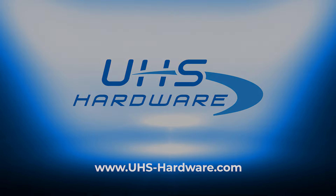When it's all said and done, you should just have a brake light showing. Once you have that, go ahead and hit okay. It gained access — gives us our component security as well as event, and shows we got two keys programmed. It tells us if we're programming unlock keys hit yes, and if you want to erase the keys or not you can select no if you only want to add. So we're going to tell it one key.